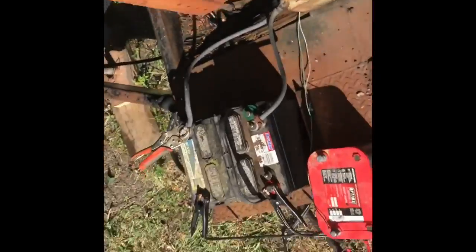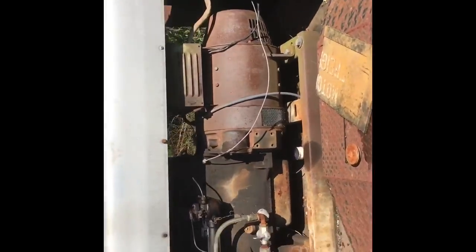We may be burning a little oil from an oil leak — I can't quite see myself, but it looks more like burning oil. So it looks like I'll be doing some cleaning. The exhaust from what you can see here is completely missing, so I will be putting exhaust on it. It's an old oil bath air cleaner, and the breather may be what's leaking, so that may wind up being an easy fix.